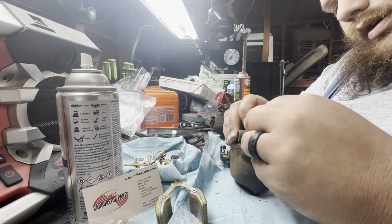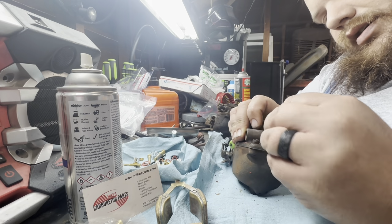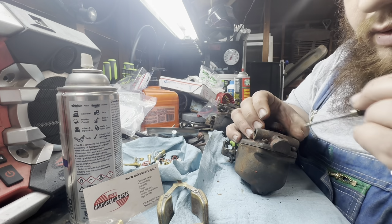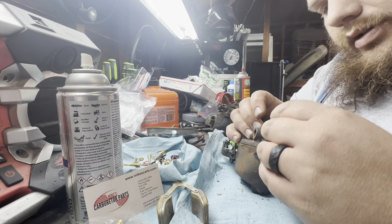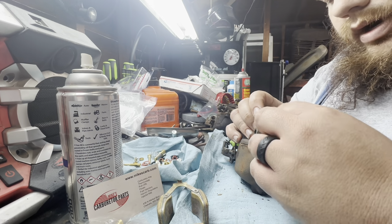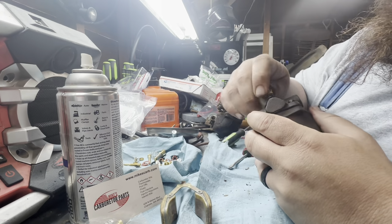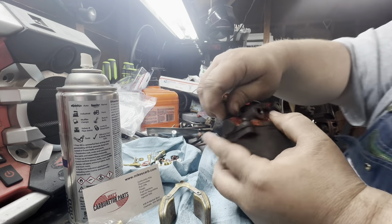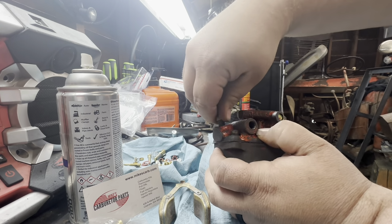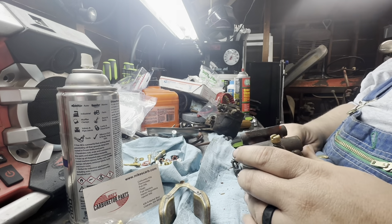If you're talking, you should probably look at what you're doing, and not just start. Making sure that thing gets started straight. That's better. Wonder why this thing is going in tight? Oh, because it's going in super raw on there, dum-dum. That looks a whole lot better. I usually go tight and then just loosen it up a little bit and let some fuel in. We'll get the rest of that adjustment later on.